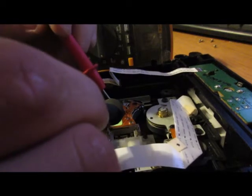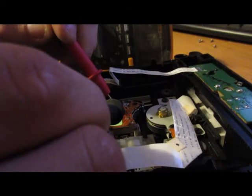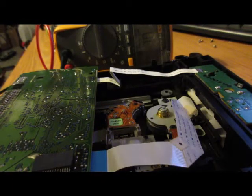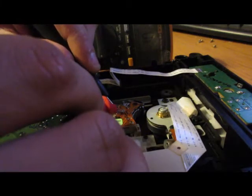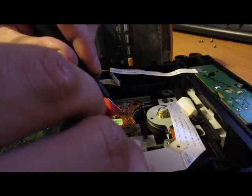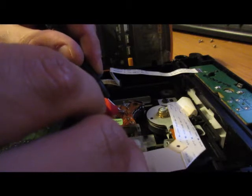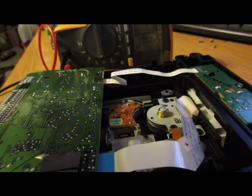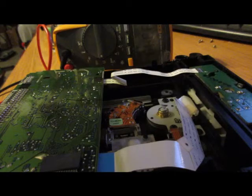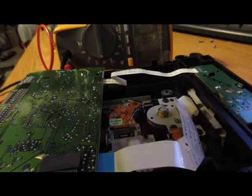It's 0.7... wow, that one's already really low. Let me make sure I got a good reading on that — my ground prong is a little screwed up. It's at 2.08. Now generally factory set you don't want to go below three, but seeing as this drive doesn't read anyway when I got it, the person I'm selling to is expecting it not to read.